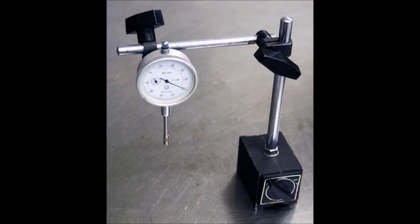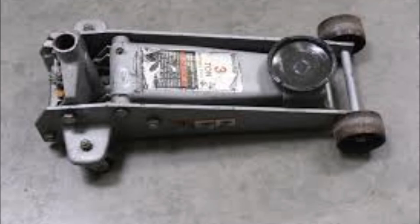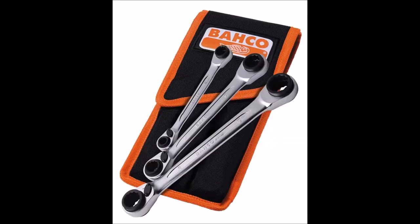One of the first things you should have is a dial indicator — you'll need this to set the differential up properly and make sure the teeth are aligning. You also need the paste that goes on the teeth of the differential to see your pattern once you've adjusted it. An essential tool is a hydraulic jack to lift the vehicle up and down, compress the springs, and hold things as you work. You'll also need jack stands and a torque wrench to set all the values in the book.